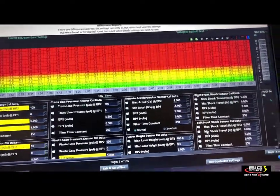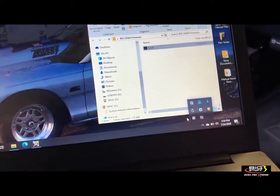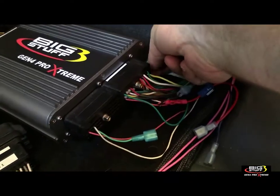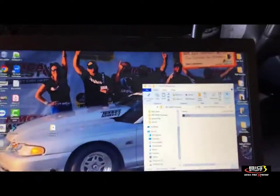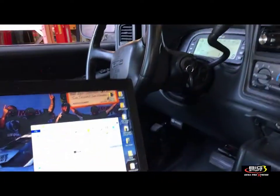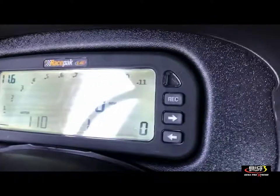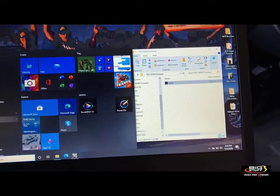I'm going to exit and close the software and go offline, because I want that to be the next step. Eject the SD card properly, take it out, then pop the SD card back into the ECU — it's in, popped in, good to go. Come back over here and turn the ignition back on. Ignition is back on, data is back up on the RacePack.